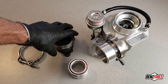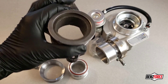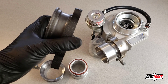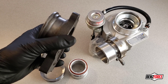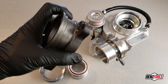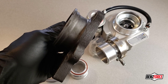So let's go ahead and look at the exhaust side. The turbos we sell happen to have the same 79 millimeter diameter flange on all of the turbos. Some people will actually buy a pre-cut flat stock in the shape of the back plate on the Holset — this happens to be an HE221, but I've seen them for HX35s and HX30s. So people will laser cut back plates and weld a standard size V-band on, or I've seen people actually cut off the back V-band off the Holset turbo itself and weld a V-band on.